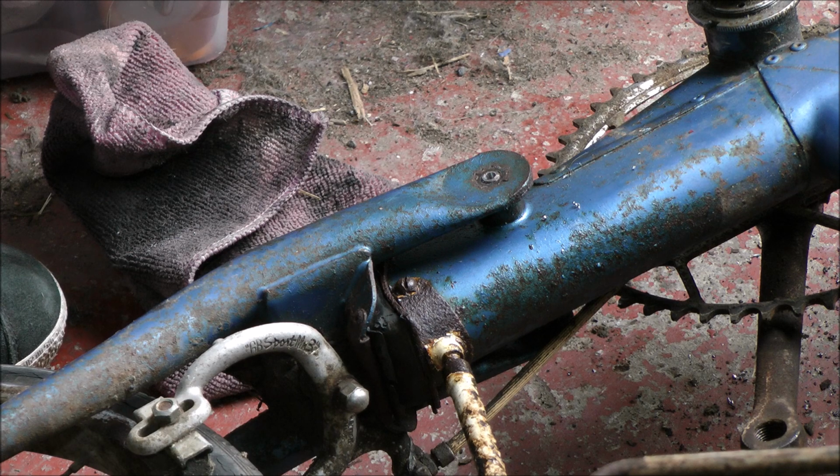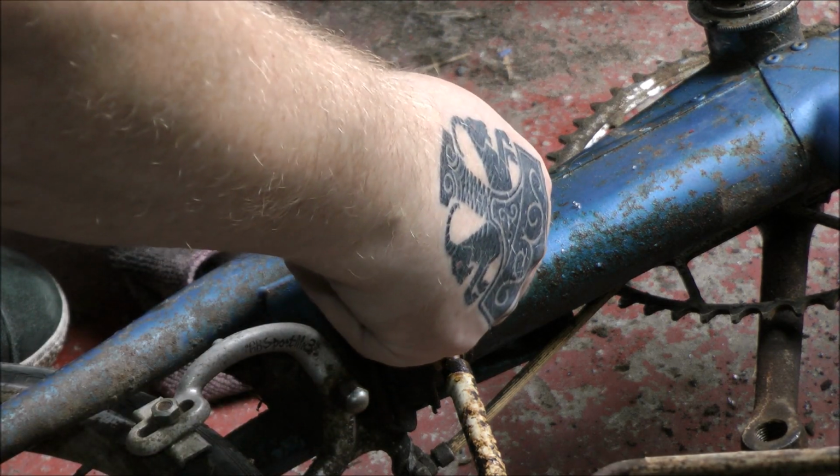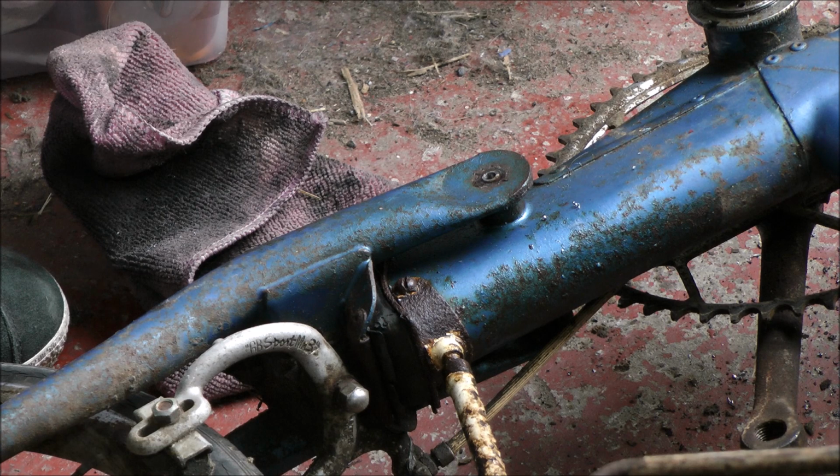if your drill just spins and it doesn't seem to be biting into the metal, it's a blunt drill bit. Try a different drill bit. Sometimes it's worthwhile just putting a drop of oil on. It doesn't stop the drill from cutting the metal. The drills don't work by abrasion, they work by actually cutting. So they're digging into the metal rather than wearing it away. So the oil actually helps that cutting motion, helps keep your drill bit sharp.